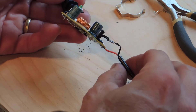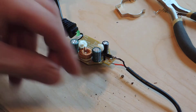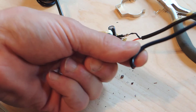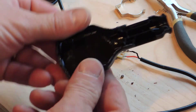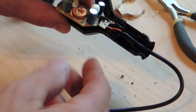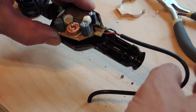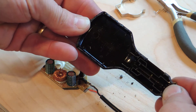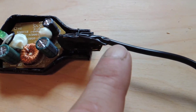Once that's done, the other side of this cable just has a positive and negative wire which you can hardwire onto your bike — using a headlight circuit or something that is switched power, so the GPS will come on and off when you need it. I'm going to put this back into the case. I'll cut off the case somewhere around here so the cable pokes out but the unit is shorter and I have more places to store it inside the headlight bezel.